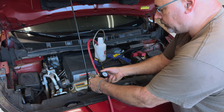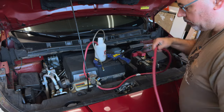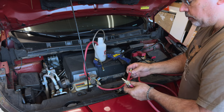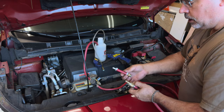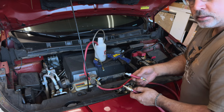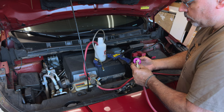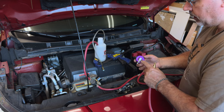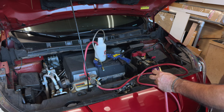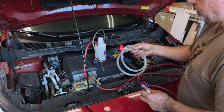What you want to do before you start is back this regulator right off counterclockwise all the way, so there's zero pressure on the system. Then you can hook it up to whatever air pressure you have. The unit came with a fitting designed to screw onto a tire valve in place of the quick release nipple — you can just hook it to a tire and use your tire pressure, which is cool. The pressure bleeders also come with caps you can order for different vehicles. This is a C1000, which fits this 2018 Nissan Leaf. I also have a Toyota version for our Highlander, and one for our Honda CR-V.